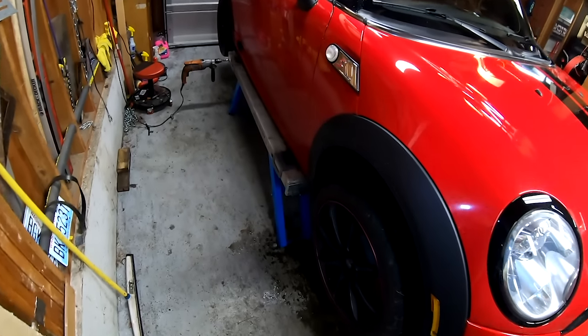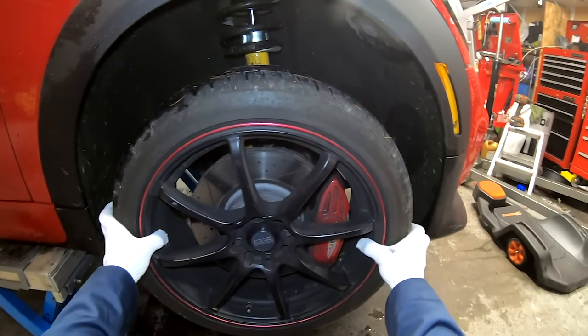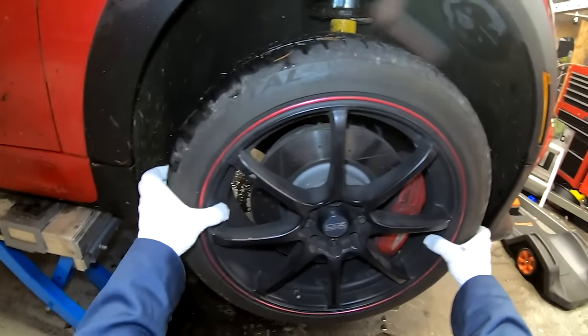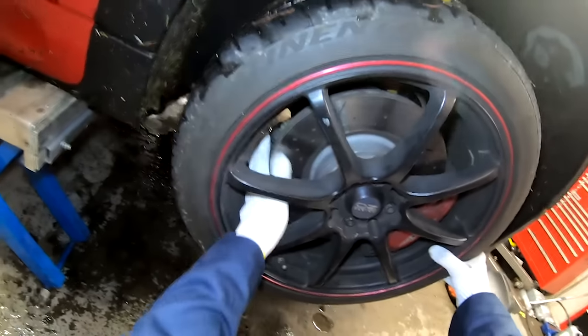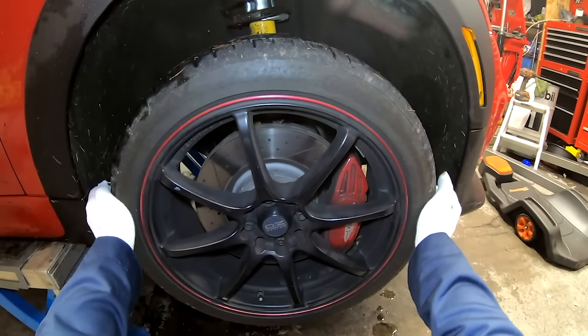We've got the car up in the air now, so check the wheels for bearing play and ball joint play. The way you do that is to pull the wheel and wiggle back and forth. Right here I'm checking also to make sure the tie rod end is not loose. Basically you're looking for any extra play, and there isn't any here.